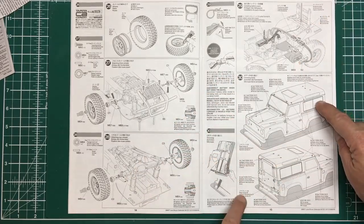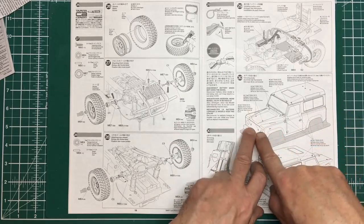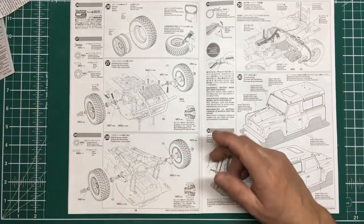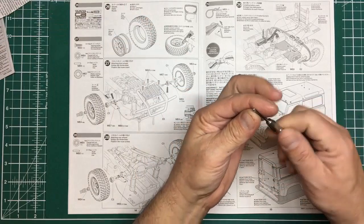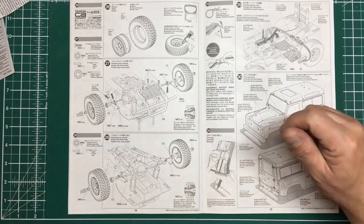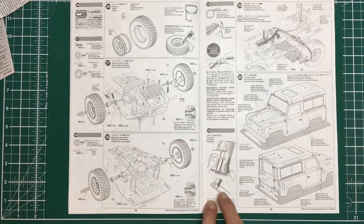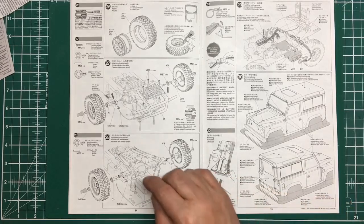After adding the wheels with simple flange nuts using the box spanner included in the kit, tidy up the wiring, add the battery, and that's the time to go and test it. For the body, you need to trim it — go around the edge and drill holes, but be careful. Don't go straight in with a large drill. Start smaller and open up gently, or use a little burring tool — like a dental burr around 3mm diameter — which is better for cutting polycarbonate than a drill, which tends to rip out sections.